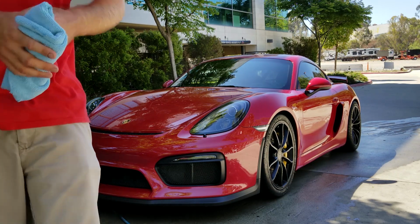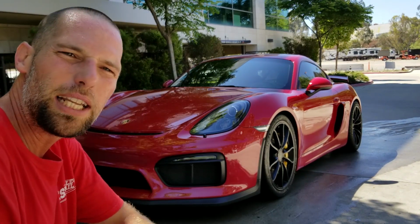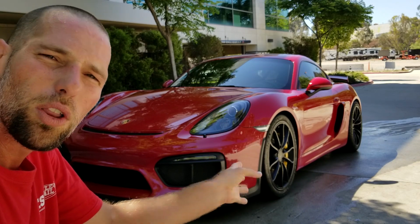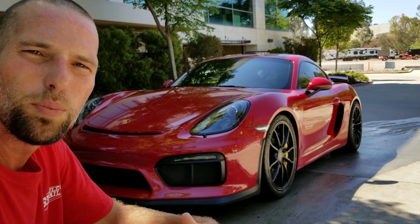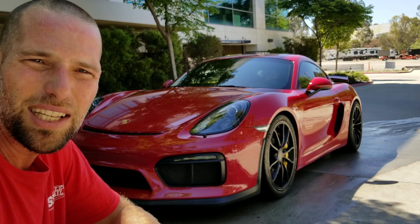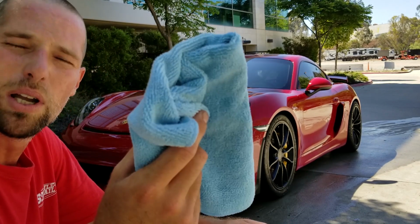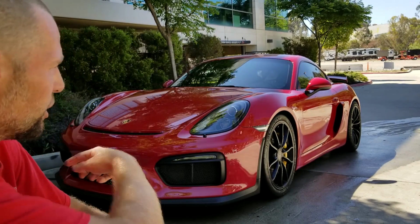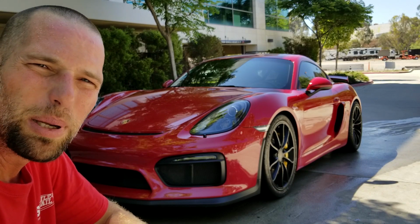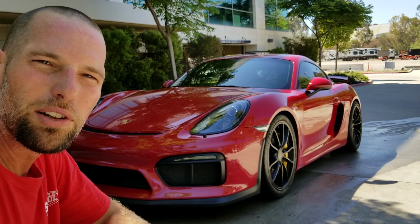So again, you're gonna wash the car, get it all clean, then you're gonna spray it with the TLC with the foam cannon while the car is still wet. Then you're gonna take two bigger microfibers and you're gonna dry the whole car. You might see a little bit of blotchy and haziness, but that's okay. Then you're gonna grab a new smaller microfiber, and you're just going to do a final wipe down on the whole entire car, and you're done. Whole entire car will now be protected. Thanks for watching. Hope that all explains everything for you.